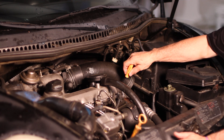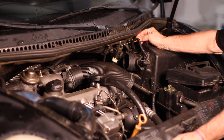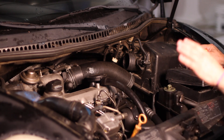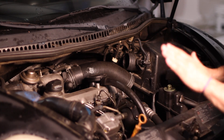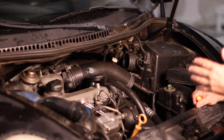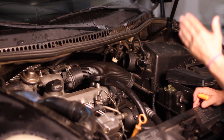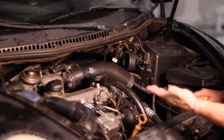Vacuum comes out of here, goes down activating the brakes, and comes up to the N75 and also the N118. The N118 is another vacuum device that activates and operates what we call the EGR valve on a turbo diesel. The EGR valve is there for a couple of reasons: for a smooth shutdown, there's a little flapper valve inside that closes down the air going into the intake manifold when you turn the car off, giving a nice quiet shutdown. The other reason is if you have a runaway — if a diesel starts sucking in a fuel source like oil from the bottom of the motor — cutting the air supply off will shut the motor down. That flapper valve allows your motor to be turned off in case of a runaway.